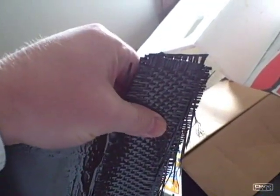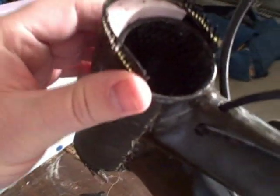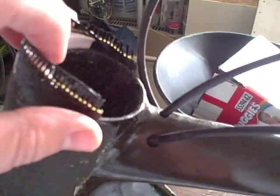Let me show you what I've got going on here. I've got the aluminum piece attached and I put three layers of carbon fiber on each side of it. I didn't peel ply it — I probably should have — but I'll just sand that down flat. It should be plenty strong. I also put a foam core on the front and wrapped that with two layers of carbon fiber. This piece is non-structural, just cosmetic so the profile matches the fork. I'm going to cut this off, drill out the foam a little, then put chopped carbon fiber strands mixed with epoxy in there so I can put a cover on it. Then I'll melt the foam out.